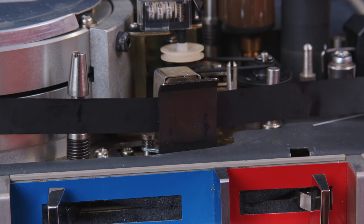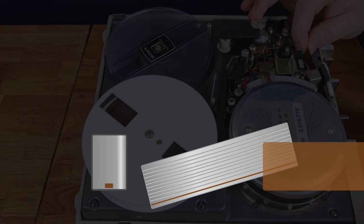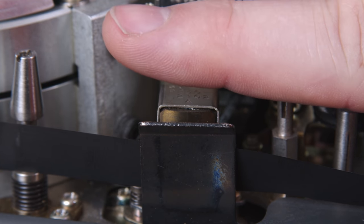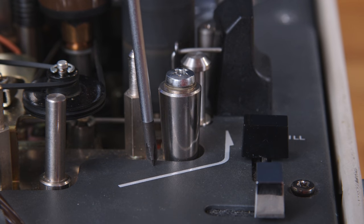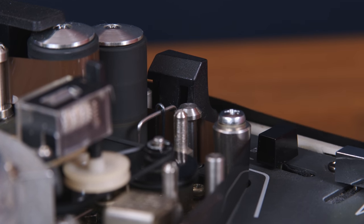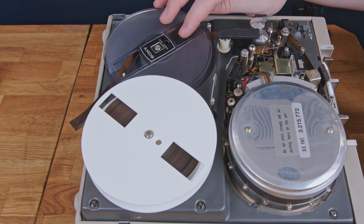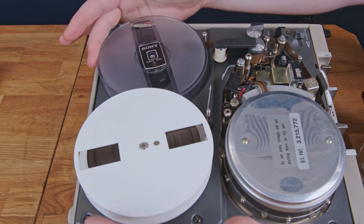Starting with the tape on the supply reel, it has to go under this guide pin to keep it taut, then over a roller, around another roller, and past the pinch roller which squeezes the tape against the capstan. We come up around here and over this guide pin, which has a bevel on it that tilts the tape slightly, making it want to wrap downward. We go across the erase head, over another guide, and then wrap the tape around the video drum — as it spirals downward, even though the slot is in a straight line relative to the machine, relative to the tape it's a diagonal. That's how we get our helical recording. Notice the reels are at different heights because the tape actually descends as it wraps around the head.